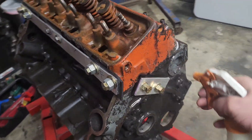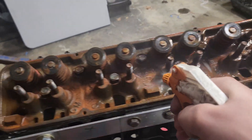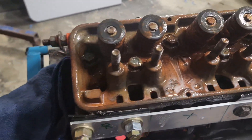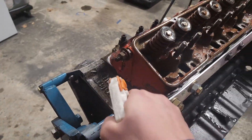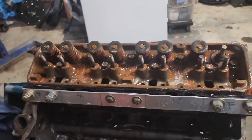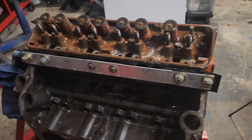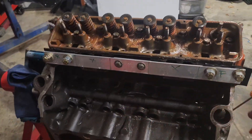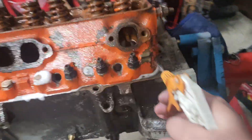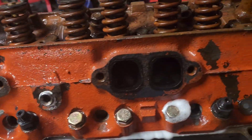Let me check this front section. Nothing there. Looks pretty good. The advantage of doing it with the head on here is that you can at least sort of check the head. There are some places on these heads on the underside you're going to want to check that we're not going to be able to do with this method, but at least it gives you some sort of a general idea of the health of the head. If it's an unknown head to you, so far this looks good. I'm spraying in here in the exhaust so I can see just a quick check of how the exhausts are sealing.